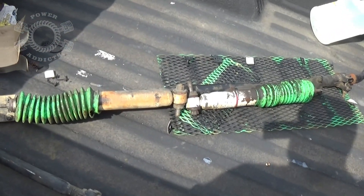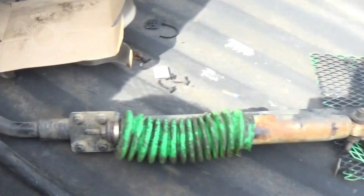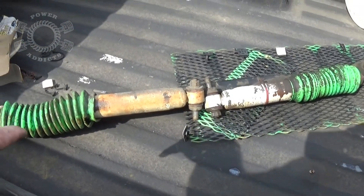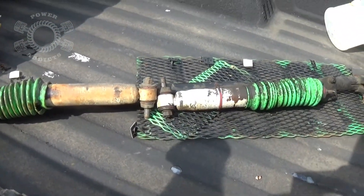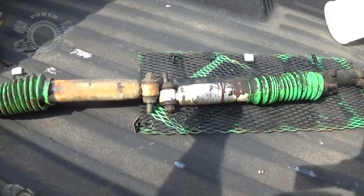So there's the setup — you can see the stabilizers are set up on top of the tie rod. That is actually a benefit for relocation purposes because it puts the shocks out of harm's way. Like if you come through your wheel and hit a rock on the tie rod, it's not going to get to the tube of your stabilizer. Now am I a fan of dual stabilizers? No, I absolutely am not.